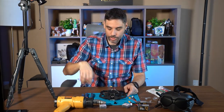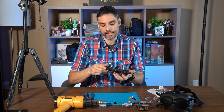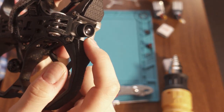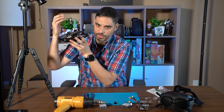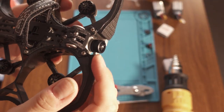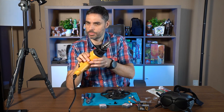Now we're gonna heat the lens. They put glue to fix the lens to the armature so it doesn't fall off when you fly, and also to lock the focus so it won't screw up mid-flight. We're gonna apply about 30 seconds of high heat with this heat gun. I'll mute the sound because it's gonna be loud.